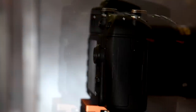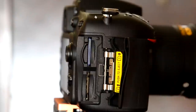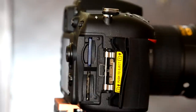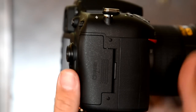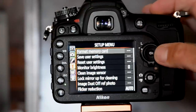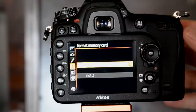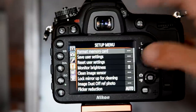Next you're going to put some cards in. The D7100 is equipped with dual SD cards and takes all the latest generation and top speed cards. The top one is your first card, the bottom one is your second. You can set up in the menu system how you want the two cards to operate. Once you put in a card, make sure it doesn't have anything important on it, then go into menu, go to the tool key, and select 'Format memory card' — choose your slot and hit OK. You're always better to format it when you first pop the card in.